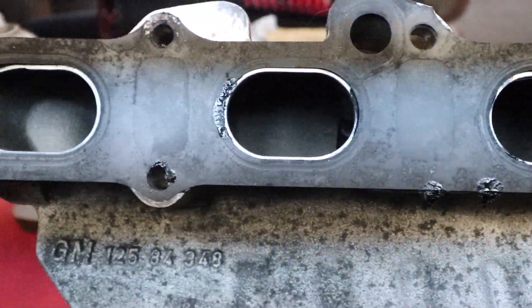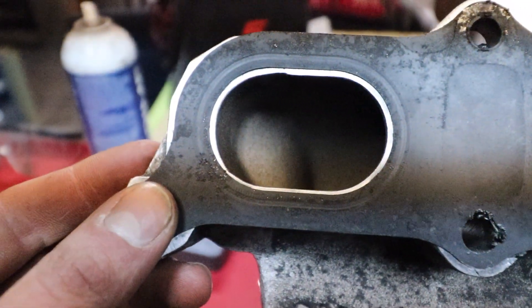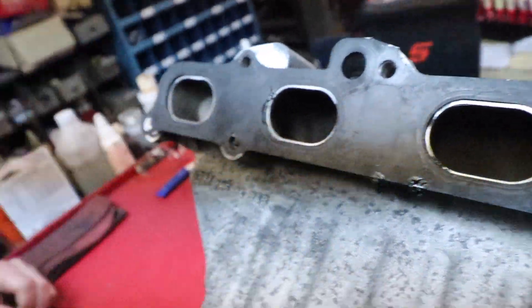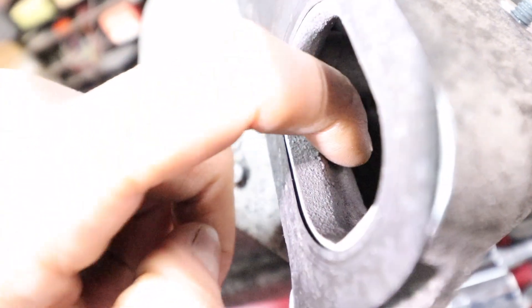Here's what it looks like when it's all pulled off — they're pretty much dead center on it. But that's only when I put the gasket up and in the right spot. If I just carelessly place the gasket on the head, that gasket might actually create a ledge — and it might have been that way from the factory — where it had a little bit of a ledge and the airflow is hitting a wall, which could kill a lot of flow. So I'm just gonna touch this a little bit; I don't want to bring it completely out to the line.